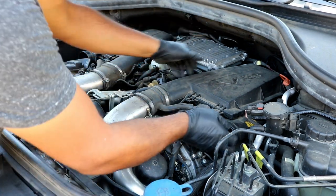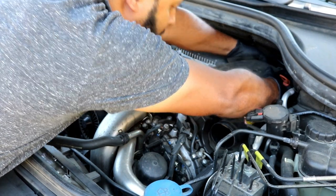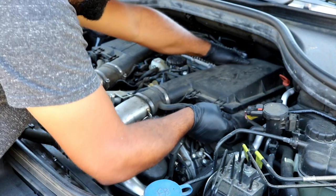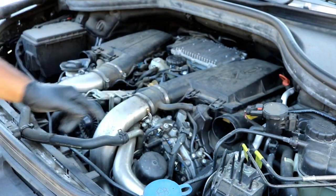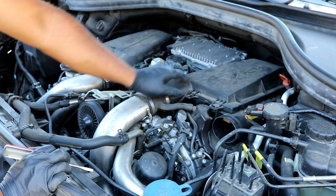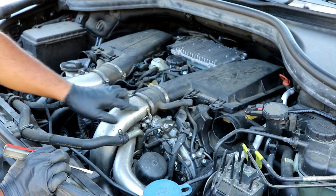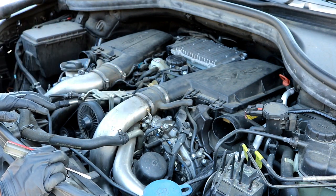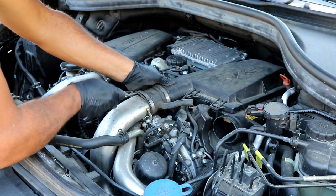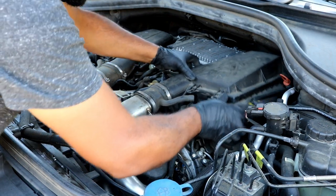Now you need to lift up this entire unit. I would start by lifting up the back first — it literally pops straight off like that. You'll probably just want to remove this whole piece along with the plastic. Don't forget to take this piece off right here. Be careful with this stuff — you don't want any cracks because you'll get vacuum leaks, and these engines are pretty particular about vacuum leaks. You just have to lift these off and kind of maneuver them off the pipe.